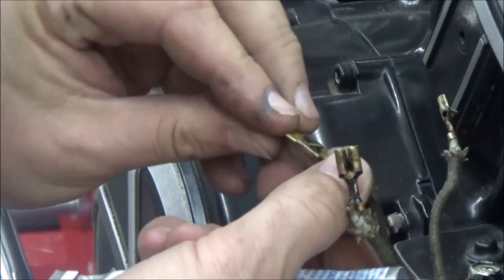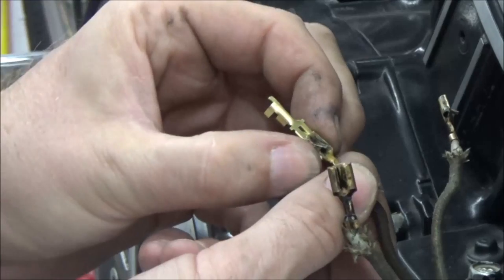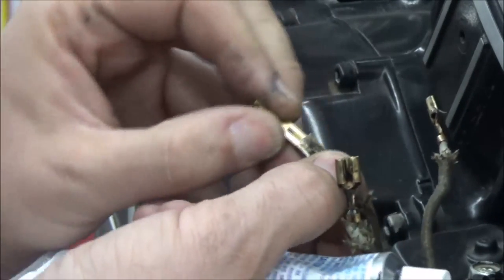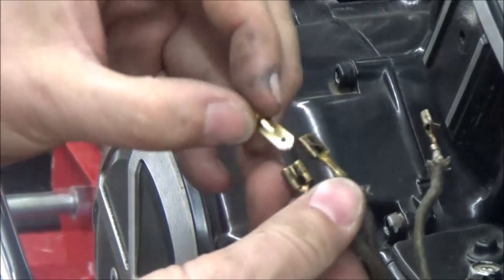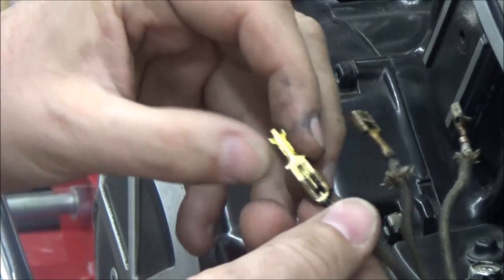Regardless, I've got to make sure all three are good — this one's loose, this one's actually spread apart, so it definitely needs some work. If I have a loss of integrity on one of these lines it's ultimately going to affect the system as a whole. That's my tip of the day: verify multi-pin connectors by checking them one at a time with the new connector.